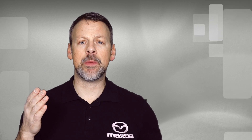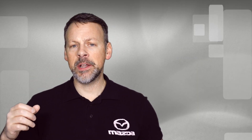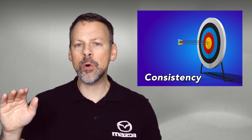Suffice it to say, I was pretty happy with these results. And again, I'm not talking about the numbers — of course the numbers are different. We initially dynoed on a Mustang Dynamometer; this time it's on a DynoJet. Typically a Mustang is going to read lower. I'm talking about the fact that now we have three — actually four — solid, consistent runs where the horsepower was right in line with one another.